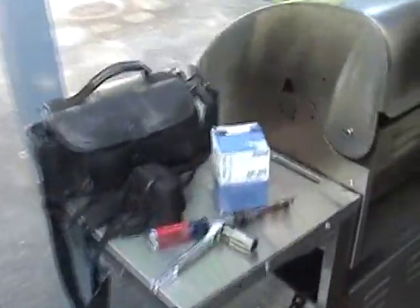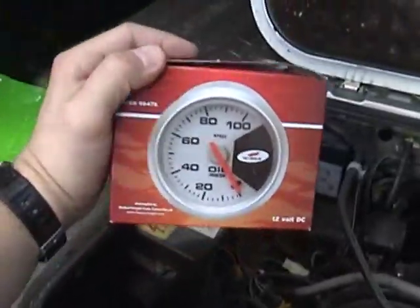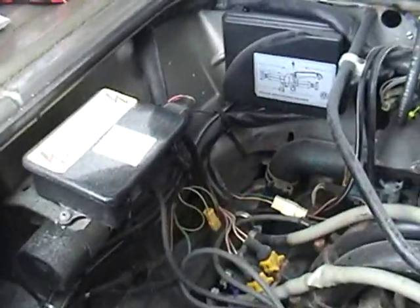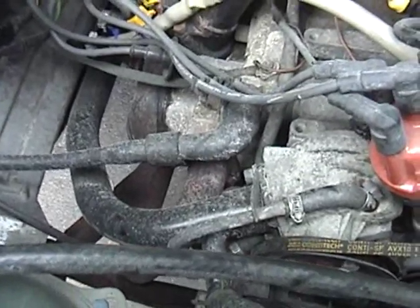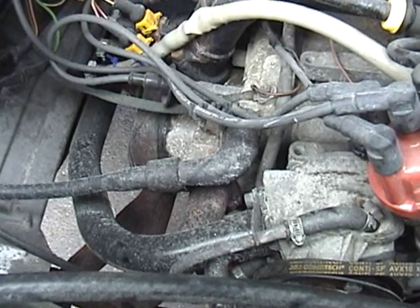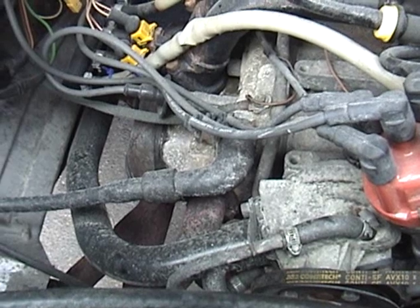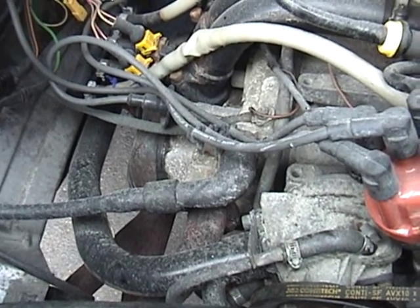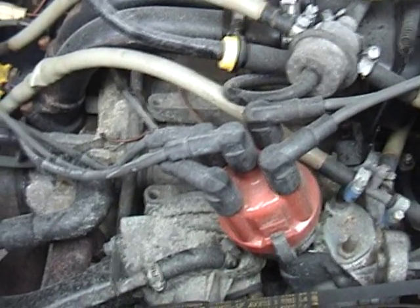So one of the things I'm going to do is replace that with the correct German oil filter. But also today I'm going to plumb a new oil pressure gauge to mount on the dashboard. This picture makes it look way bigger than it really is — there it is right there. I'm not going to do a perfectly clean installation today; you'll see wires running and whatnot. Basically I'm going to tee it into the system in tandem with the low pressure sensor, which is located between the driver side push rods. When I get this all together with the new filter and refill the oil and drive it, I'll be able to get an actual number for oil pressure and compare that to factory specs — that will give me an idea of whether or not the engine actually has a problem.